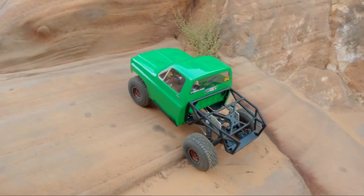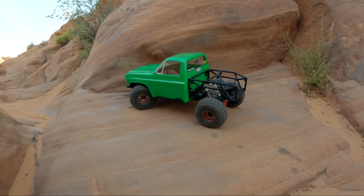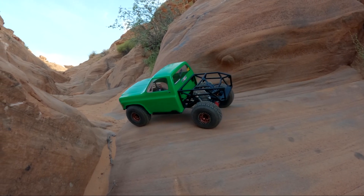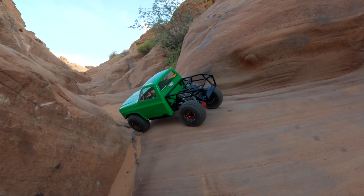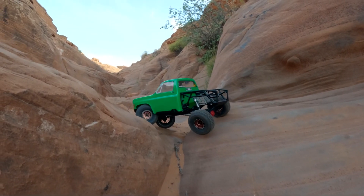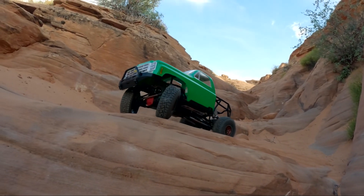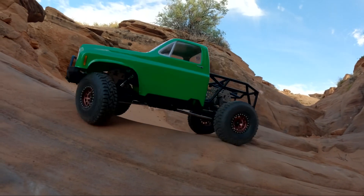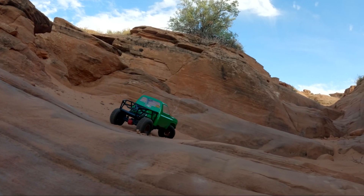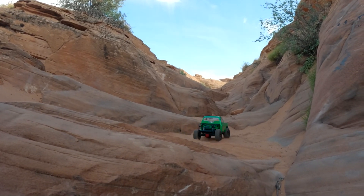This is my first outing with this truck and it's geared a little tall because it started out as a portal truck and I never changed the transmission gears to reduce the gear ratio for better crawling, so it might be a little jumpy. I also don't have any weights or overdrive in the truck, so it's a pretty basic Basecamp. Let's cruise around some rocks and I'll show you how I like to utilize the dig function in the SCX-10-3 LCXU transmission with a dig unit.